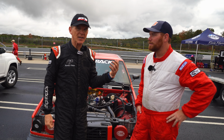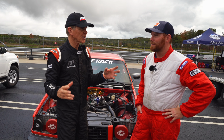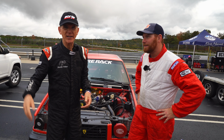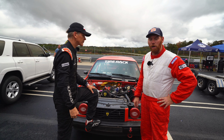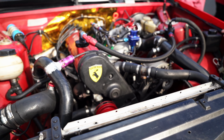Oh, yeah. So this is another Volvo turbo. It's older, but it's bigger. It's Garrett, right? Garrett T3, just a standard Garrett T3. Yeah, all you turbo guys will know that. That and a little cheap blow-off valve, because the Garrett doesn't have the internal blow-off valve like the Mitsubishi does, so we had to put that on there.